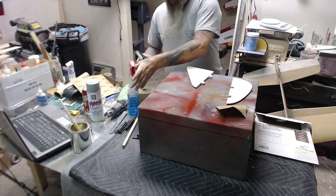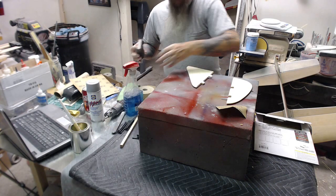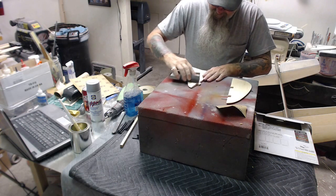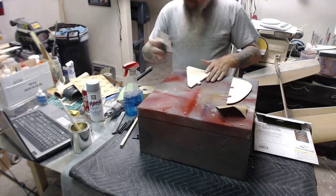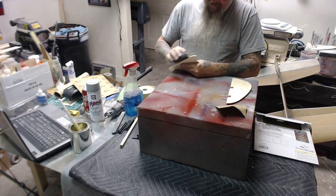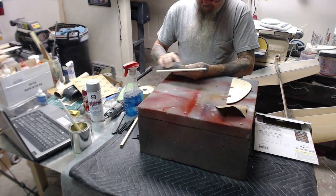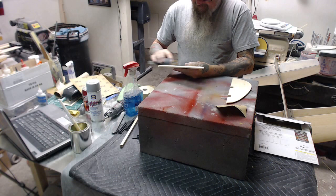This is color sanding. And you say, well, what do you mean color sanding? It's not color. Well, normally when you're doing this type of sanding with 1200, you're going from one color to the next. And any of the painters know what I'm talking about. And what we're going to end up with here when I get this all flat is that this piece is going to be ready. Well, it's ready to paint right now, basically, without any primer. But it's going to be like a piece of plastic or a piece of metal.